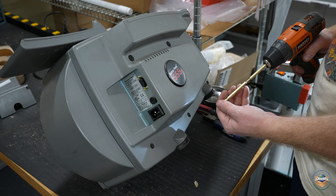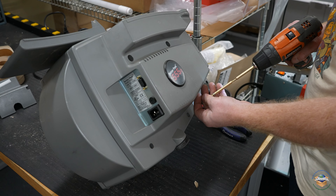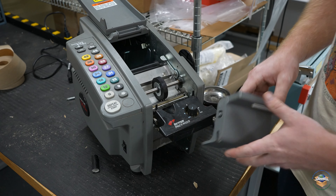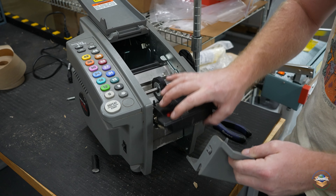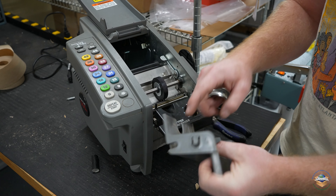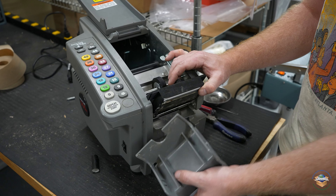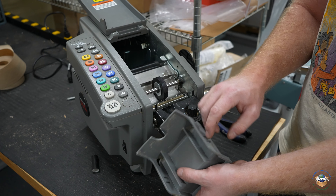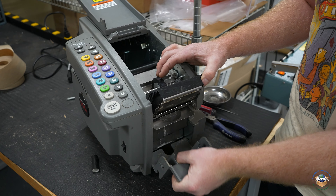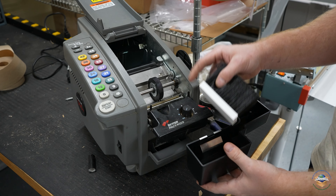Go ahead and put on the other side cover. Remember we've already got one screw in there — make sure we put the other in. There's no such thing as leftover screws. One thing I've left off is this tank shelf here, and one reason I do that is once you have these covers on it will protect your little nibs from scraping up against the side frame. If you repair the same machine over and over again, over time these little nibs can get fragile on you. So I always wait till the side covers are on, then snap it in place.